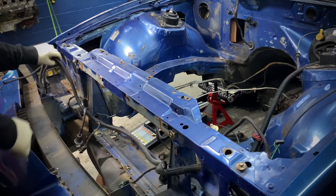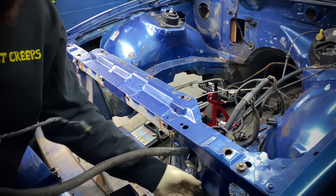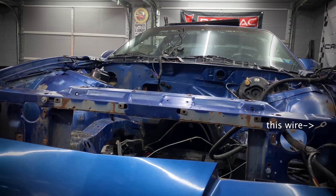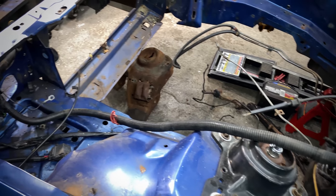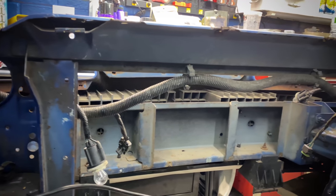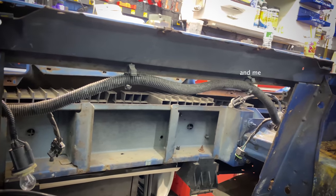Now, being this harness does contain the wiring going to the headlights and all the lighting in the front end, just be aware there are a couple of grounding points at the core support. I think there's one on each side that's held to the chassis with a 10 millimeter headed self-tapping screw, one on both sides. There may be another one here or there. Just keep a lookout for any grounding points and slowly kind of route the harness through the core support. It's also held in place with some clips underneath the core support that runs along the radiator,